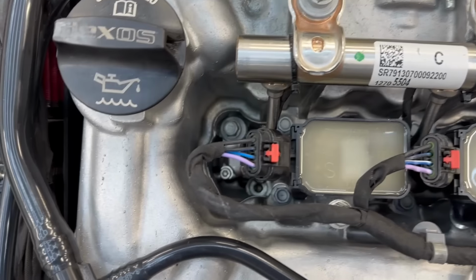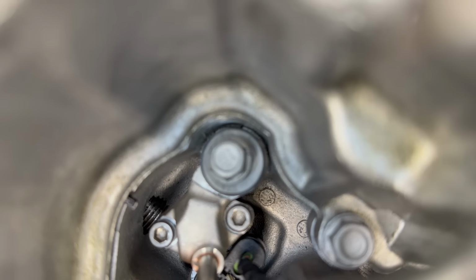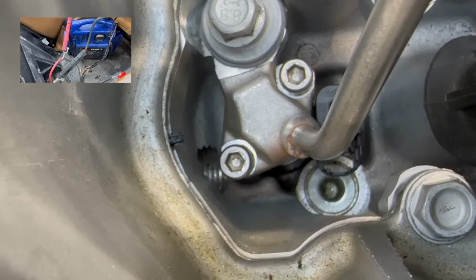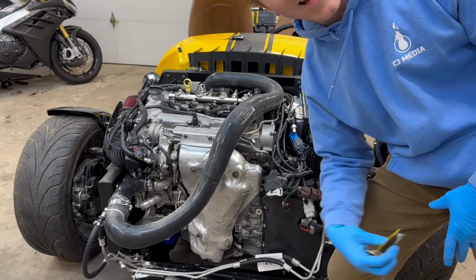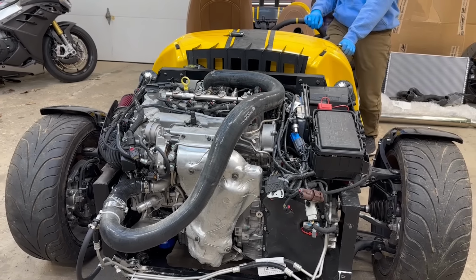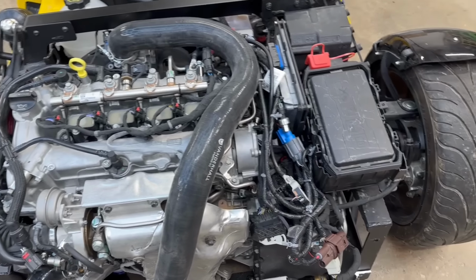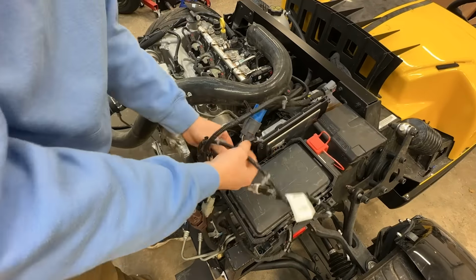All right, you guys watch. I'm gonna turn the key over. Turning the key. Foot's on the brake. No more leaking. Let's try to crank it again. Jump pack says it's at 12 volts. Sounds like it doesn't have enough battery, but let's go through this wiring here while we let that battery charge, try to figure something out.